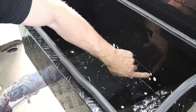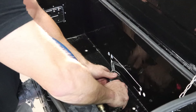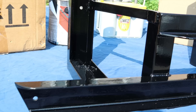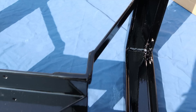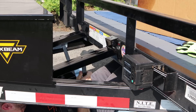We drilled some holes in the four corners so we can get our saw in there and cut the rest of it out. We got our winch mount back from being powder coated. I did bevel these edges off because I don't want to whack my shins on them — that'll soften the blow. These edges too, in case I'm ever underneath the trailer. So now we're all ready for the fun part: putting it all together.